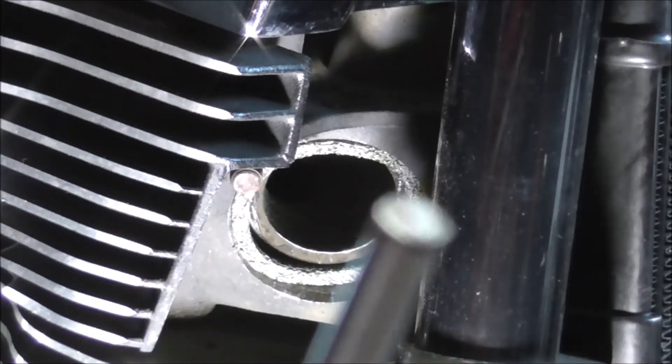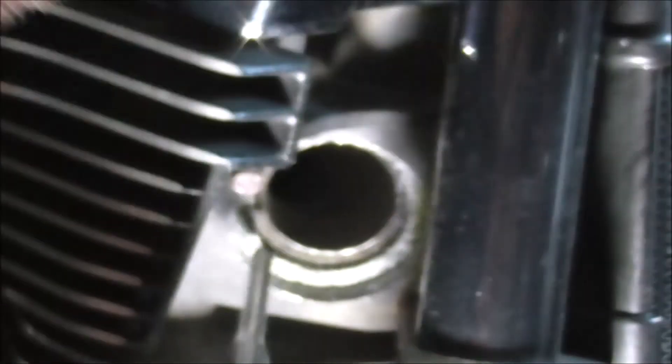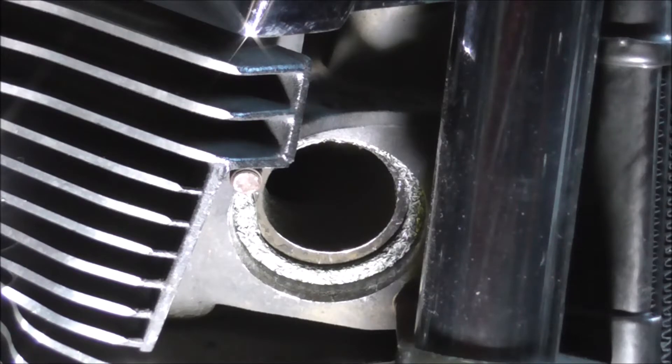What I do is I just get a little punch and slowly work my way around to push the gasket into place, trying to get it to go all the way down evenly without rolling on itself. I had it once before where I just pushed one in willy-nilly and it sort of rolled on itself, and I always had a blow from that gasket.